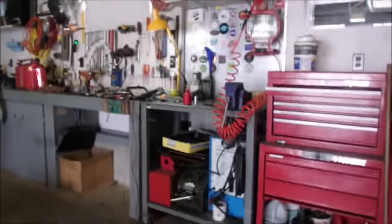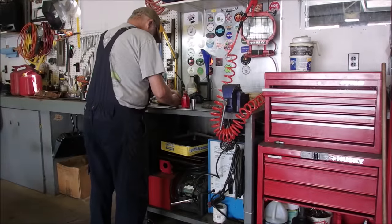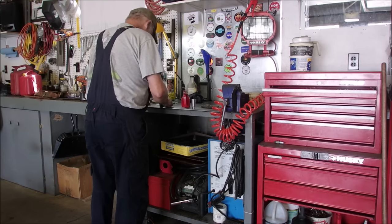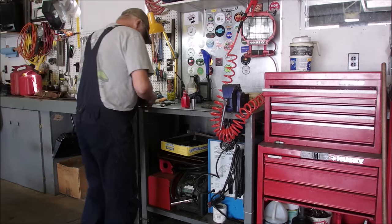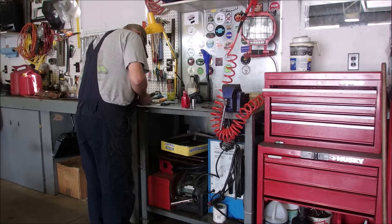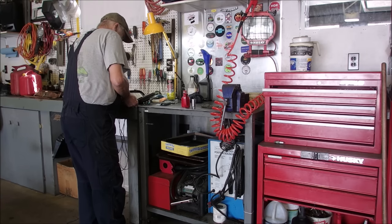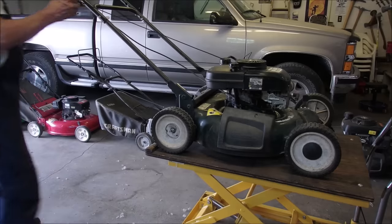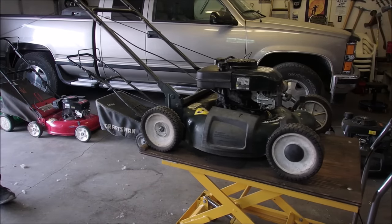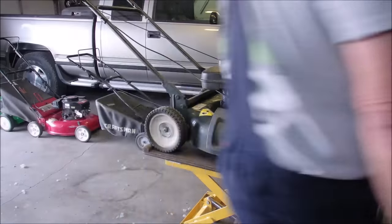Okay, there we are over there testing a spark plug. I just file a little shiny spot on the end of the spark plug, right? Gives me something to measure to. Ohmage. Off the wood. 3.3 ohms. It should be good. I think we got a bad coil.